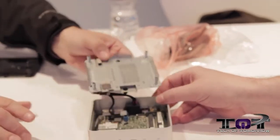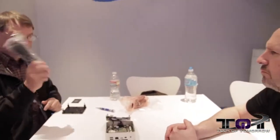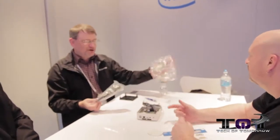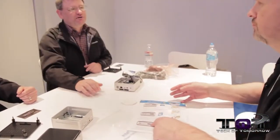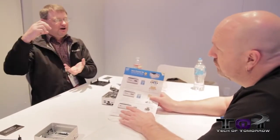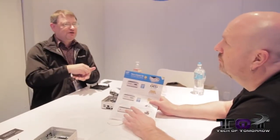Something worth mentioning: in previous generations of NUC, we did not ship with power cords and people got annoyed by that. All production versions of the NUC now ship with power cords — multiple countries are supported. We use the standard power brick with different power cords and connectors for different regions. For the Celeron model, we're going with a wall wart since it's only 35 watts — lower power, so we don't need the 65-watt brick. It has all the different geo connectors, so you slide off the cover and slide on whichever connector you need — US, EU, UK, whatever.